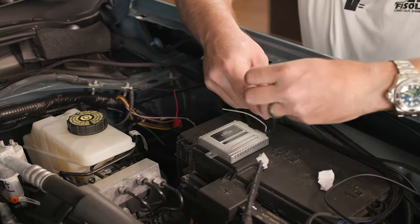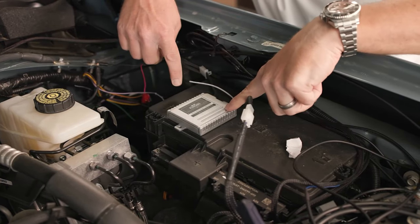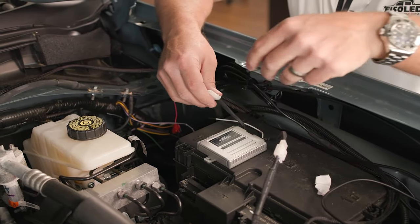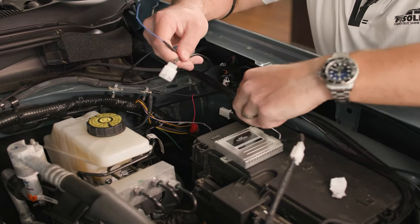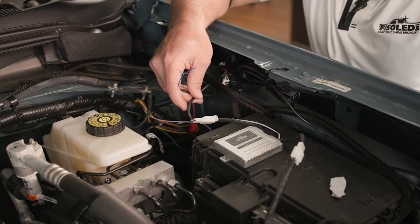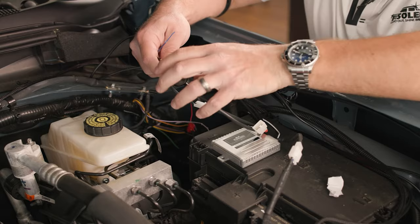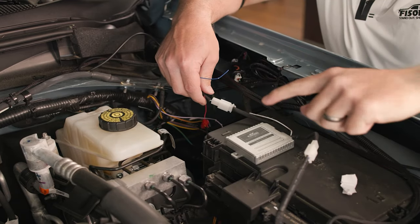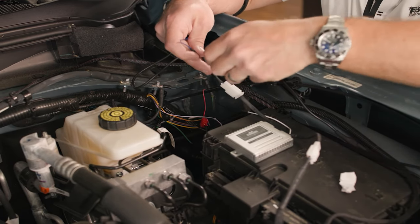It's a great addition. From your harness side you're going to plug in here on this side of the wireless receiver, and then on the other side of the receiver you can still use physical switches. If you're using the aux switch, like this truck is equipped with, you're going to plug in this white connector here with a single wire. If your Bronco wasn't equipped with aux switches, you can still use a premium in-dash switch run through the rubber grommet below your aux switch connectors. In this case we're using the wireless module with the aux switch connector — that gives us wireless control and control with our aux switch on the inside.